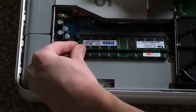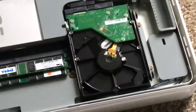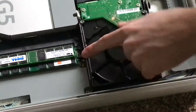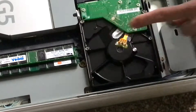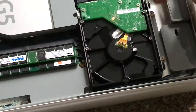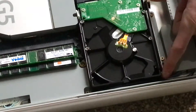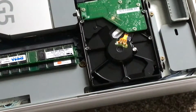The hard drive sits right up above the RAM. I believe there's one screw here and one screw here, and then you have these two screws. All you need to do is take out those four screws and then you can actually slip out the hard drive. So that's how you replace the hard drive if you ever choose to do that.